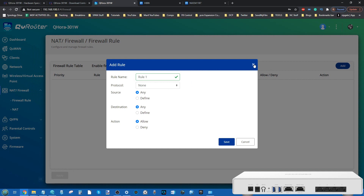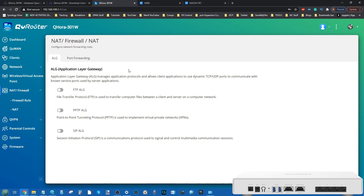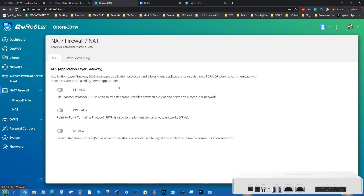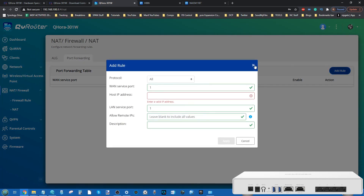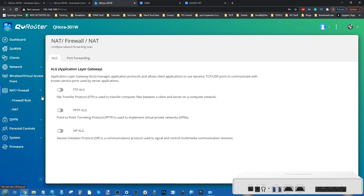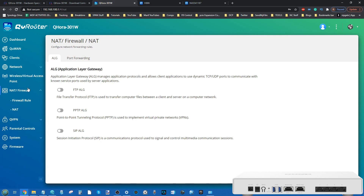For business users not using SD-WAN capabilities but wanting decent firewall control, these controls seem light on the ground — I hope to see those upgraded over the product's life. There is a noticeable difference between the firewall UI — where I'd like more configuration options — and the NAT section, which has far more options and port forwarding readily available. That level of detail seems absent in other areas, and I hope to see more firmware upgrades extending control in port definition and WAN/LAN configuration.